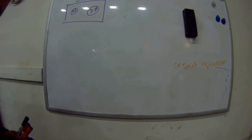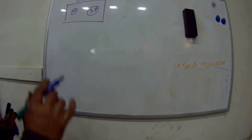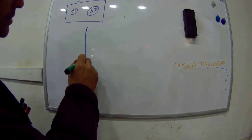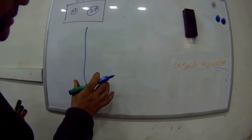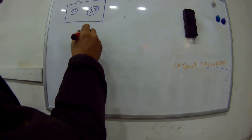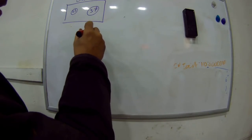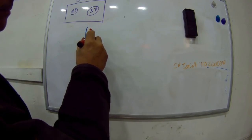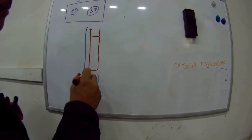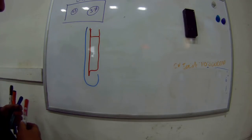It's hard to believe I've got a diploma for engineering drawing, but I can't draw for my life, so bear with me. So this is going to be a cross-section of the bottom of a Land Rover door. So this is the door skin, and it's coming round like this. It's crimped at the bottom. The frame is made up of several parts. It's made up of a flat section, and it's also got a U-channel that's spot welded here that comes like this, it's got an outer piece that's bent round and comes down here. So it's like three pieces. This is why Land Rover doors are expensive.